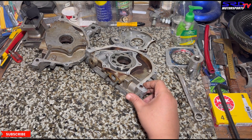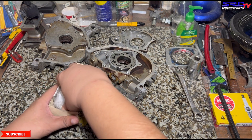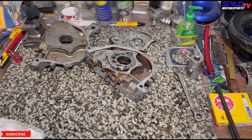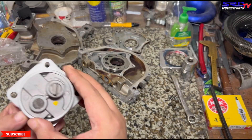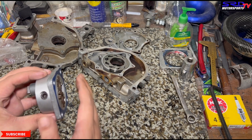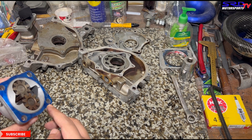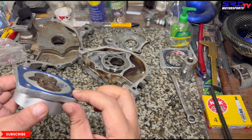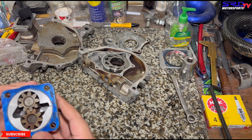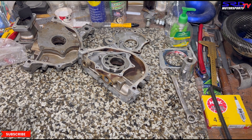Here's a similar one — this is a VW Beetle oil pump by Schaedek, made in Brazil. On this VW oil pump, the gears are of course steel and the housing is aluminum. I inked up the flange so that when you resurface it you can see if it's flat, because we're trying to reduce the side clearances to make it more efficient. Even the stock VW has a paper gasket, but for performance builds we don't use the paper gasket — as long as it's flat it won't leak. So it's similar to the Honda oil pump: steel gears and aluminum housing, same approach.